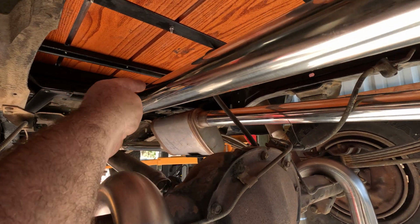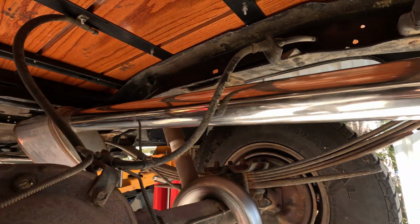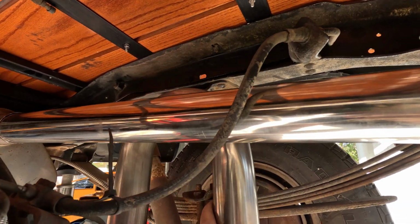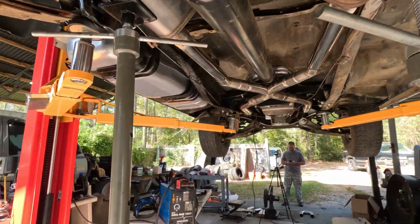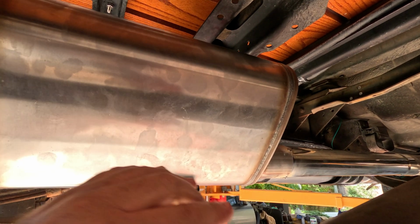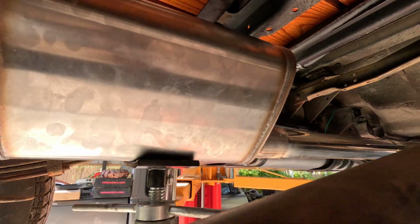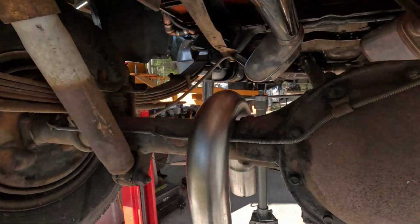We're still gonna put the humps over the axle. We're doing that now. We're gonna go up and over with these, something like this. And since the muffler has got a straight tube that goes from here to here, heat rises. So it's kind of like a secondary scavenging effect, I believe. And it'll just help get the exhaust out of it a little bit better. So here's what we're looking like.